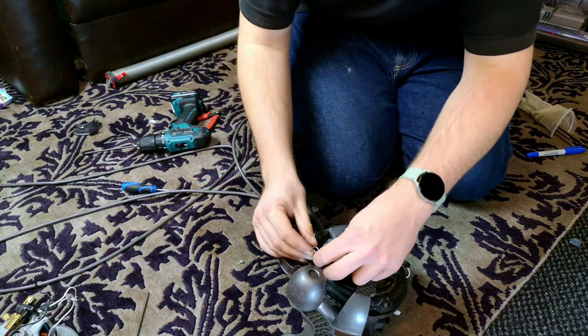It should slide over there so that bit sandwiches itself in - it literally is a massive jigsaw puzzle. Find the two screws that hold it and put them in quickly before anything moves. Hold it together and then do the screws up really quickly. Now is also a slightly good time to test it while we're only here. We can now finish smashing it back together. Put your two washers back onto this side, make sure you put your hose on as well. Twist it on by hand until you reach a certain level of resistance, then carry on the rest of the way. Grab your plastic cap, sit it inside, and give it a half-tweak just to lock it into place.